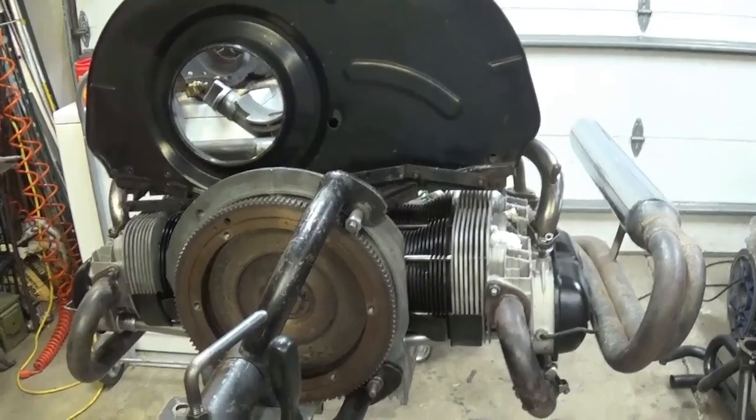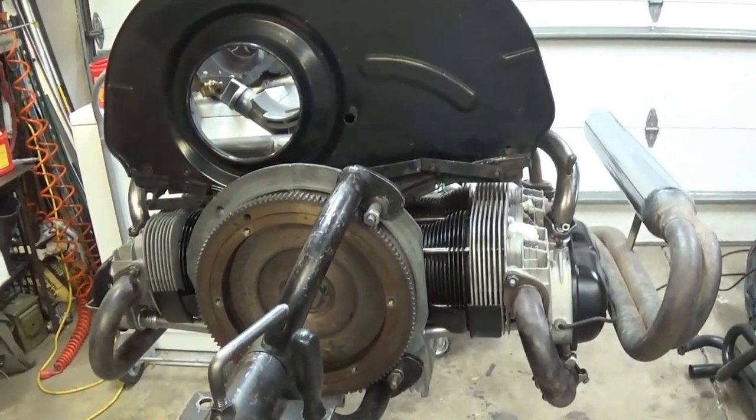You know, it is really, really fun to have big engines and big power. And I'm telling you, with a big engine, I think you thrash your engine less. You're not as hard on your engine because you don't have to gain RPM. You can get horsepower out of a 1600, 1776, and all these little engines with a 69 stroke crank, but generally you have to put a cam in them and you're revving them up, and there's just so many times when you're out on the trail or get caught in traffic, if you're using it for dual purpose, that you're not revving it all the time.